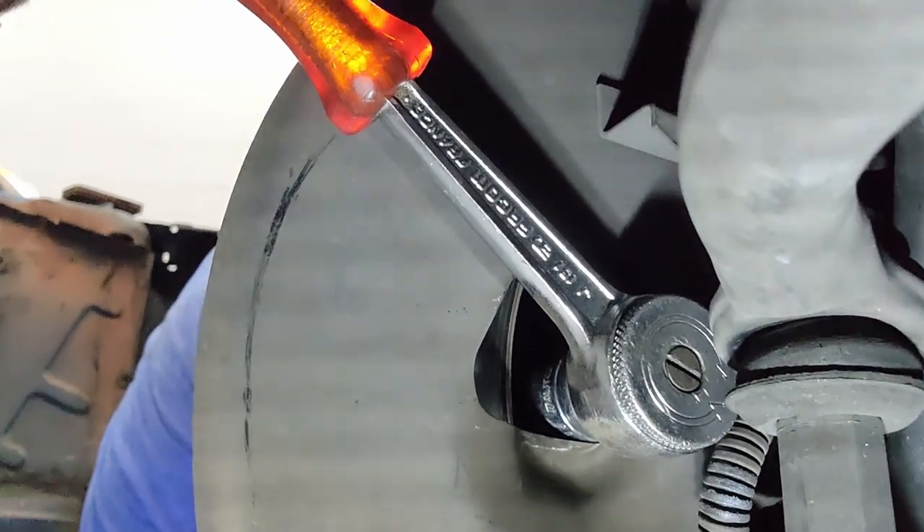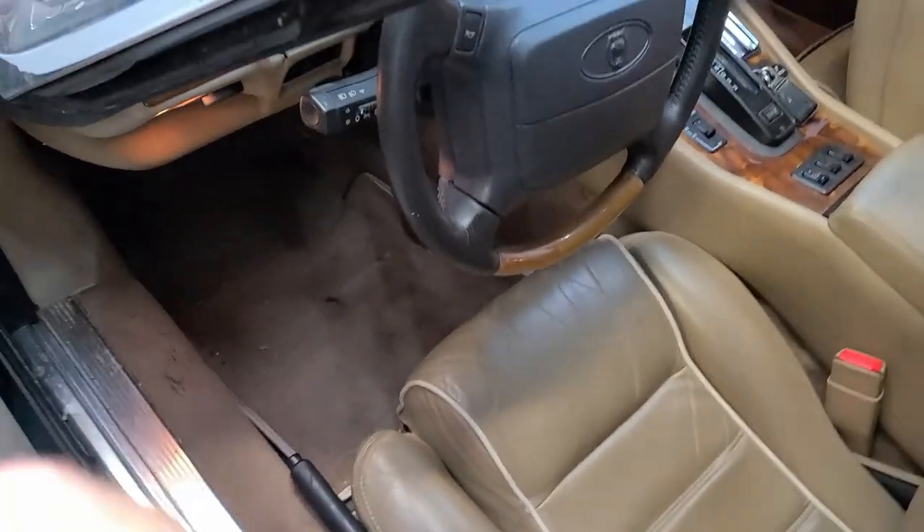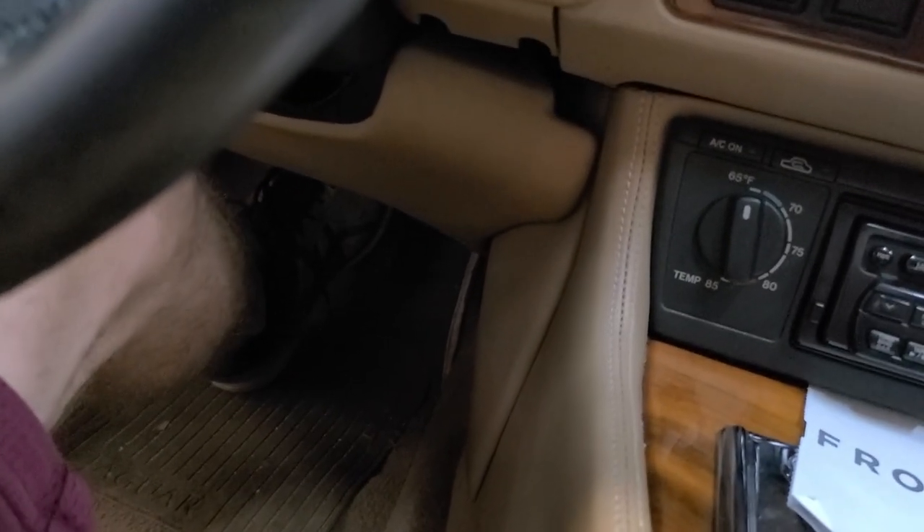James already has the socket on the next bolt, so we're going to hop in and press the brake. Those bolts can sometimes be a little seized, so while holding the brake he's using a rubber mallet to shock them just a little bit. Either using a lever or a little bit of a shock is a great way to free up those threads.